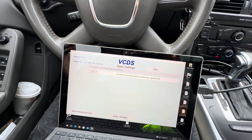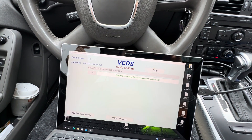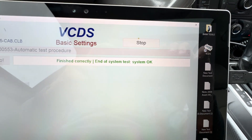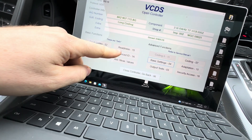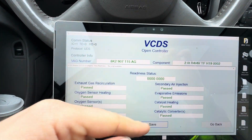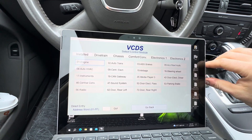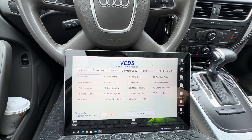After the car has been sitting and the battery has been off or dead, you can quickly run a test to make sure your monitors are all within spec. The test has been completed — finish correctly, end of system test, system okay. Release brake pedal, release gas pedal, done. Now we have every single one of them passed. This is the way to do it if you'd like to complete these tests without needing to drive your vehicle. I hope this helps somebody — I'm about to go have breakfast, have a good day.